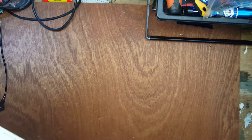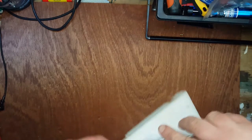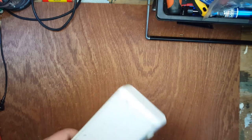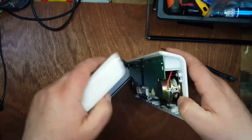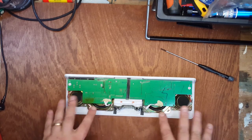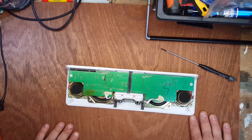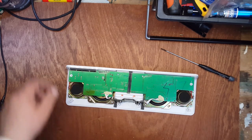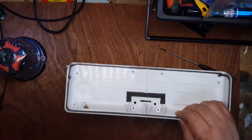So what we're going to do now is start to take this unit apart. I've already removed the screws because there's a lot of them, and I'm sure you don't need to see someone removing more screws. I am going to have to use a screwdriver to prise the thing open though, which is what I'm doing here. It's very well built. And here we go inside. As you can see, it's pretty well made. There are two speakers on each side, one for each channel, so it's not cheap. Most speakers like this would have one to cover both bass and treble, but this actually splits it out into a bass and tweeter for each channel.